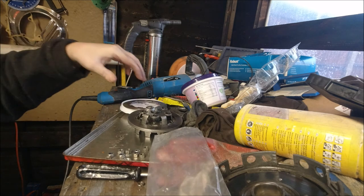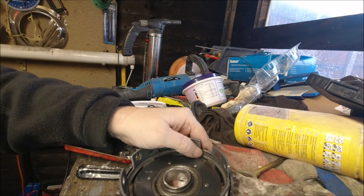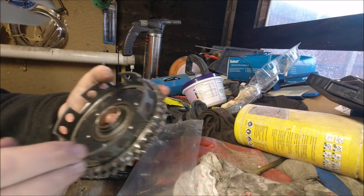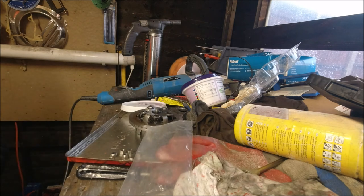Usable, definitely. Like I say, I just need the cork plates, which I could reuse again. I noticed there's a little bit of damage inside here. I don't know whether a clutch has let go before. It looks shiny, it's not old, so it's not on every one, but I wonder if the clutch got stuck in the past. Again, that wouldn't stop it working. You're looking for these edges, which are straight. They're all straight. There's no burrs or digs in them. I mean, that is reusable. It's just for 25 quid or whatever. It's just an upgrade I can do.